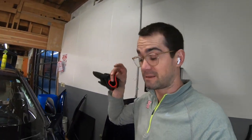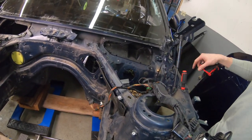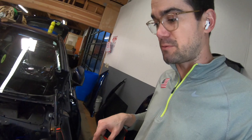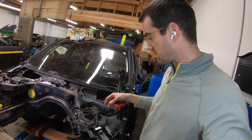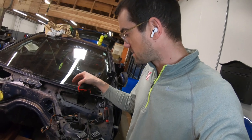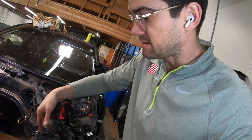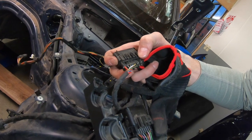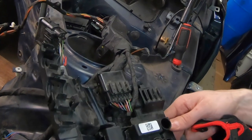Major breakthrough here in getting these wires fished through the firewall. I've got this rubber poly grommet, you know, weather protector here that I'm still gonna need to figure out how to collapse and squeeze through. But the thing that I wanna focus on is this kind of junction box. And there's no way this is gonna fit through there, you know? And so I've been wrestling around with these, and I finally figured out that they have these little bits back here, if you can see this, that you have to use a pick tool, and then it'll slide off of the plastic junction box here.